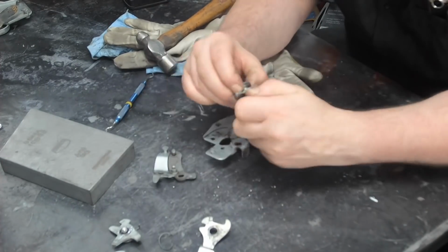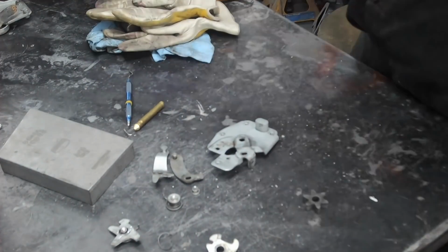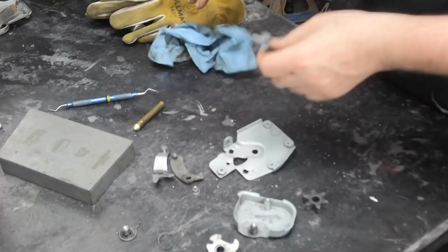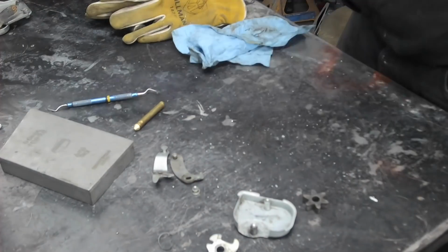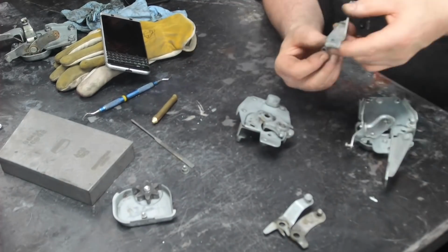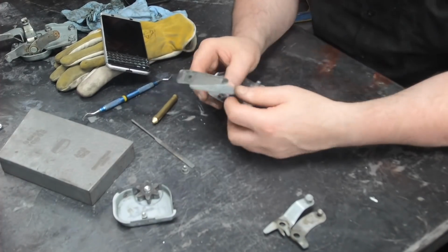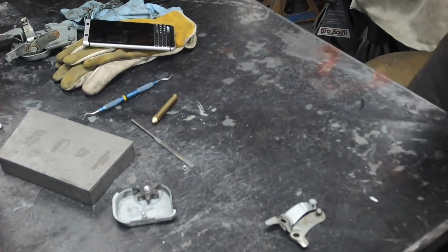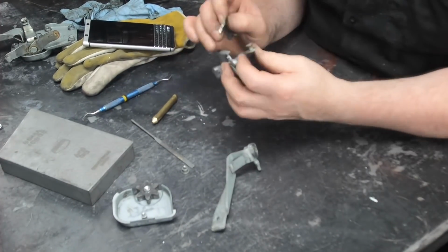These are complex door mechanisms. They are handed, they are sided. It's going to be difficult to get these back together perfectly if I don't do that step of taking the pictures and making sure I know how they work. So actually, as I take them apart, I put them back together and make sure I've had the experience of reassembling the part and make sure it works. You won't want to find that out later.